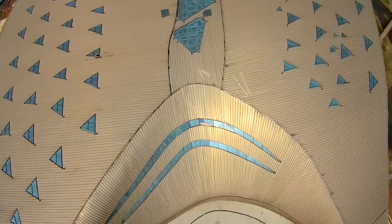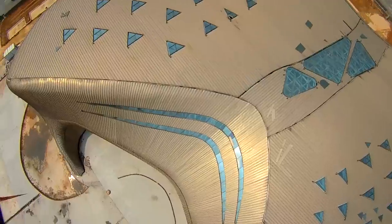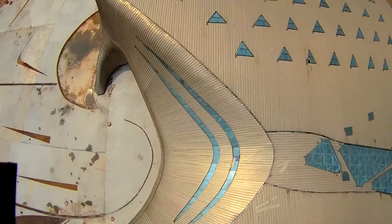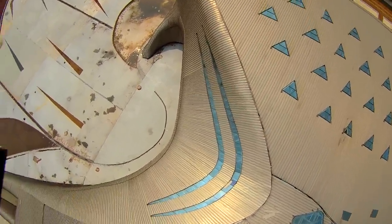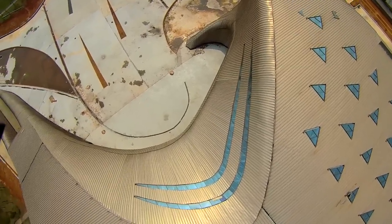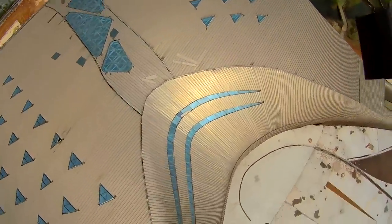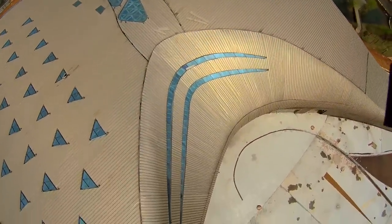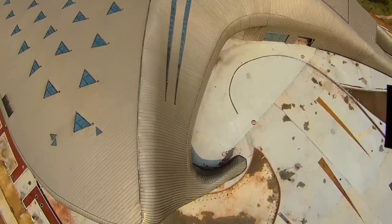As you can see, I was trying to get a very cool shot from the top of this building. I start yaw on my left and I saw the landing skids coming in, and soon after that the quad stops responding to my yaw. I yaw it more and then it goes nuts. Check this out right here. It just turns itself to the original orientation, and as soon as it did that, I activated the RTH.